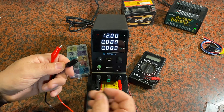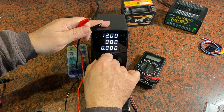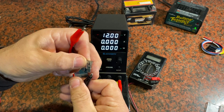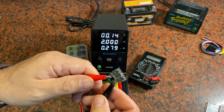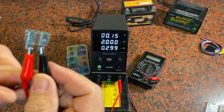This is a really cool tool — you can do a lot of things with it. Here I'm going to set an amperage of about two amps at 12 volts, and I'm going to use an automotive fuse to show how that fuse is supposed to sustain two amps. We'll connect that on there and get a little spark, and you can see I've got my fuse here.